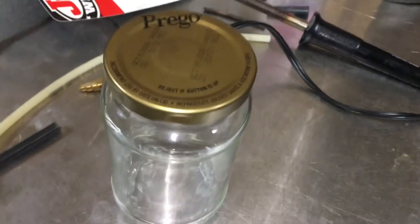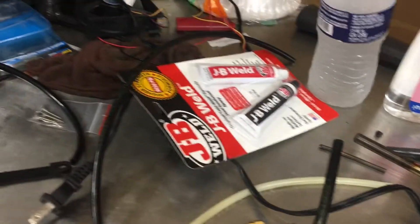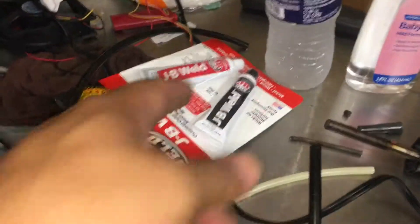I'm going to drill two smaller holes on this side here — one here and one here. These are the holes that are going to go through here, into whichever spot I choose to do my leak-down test to see where the vacuum leak is coming from.